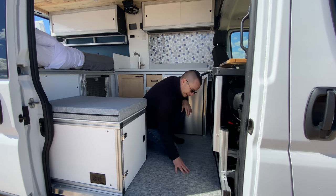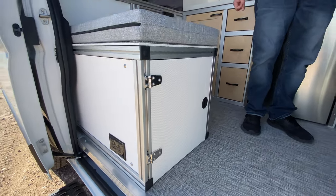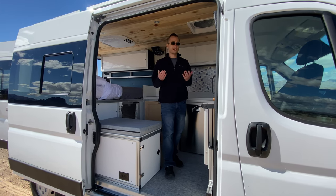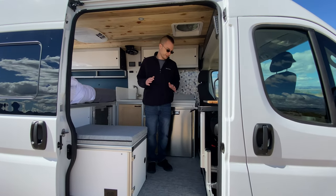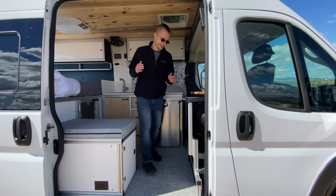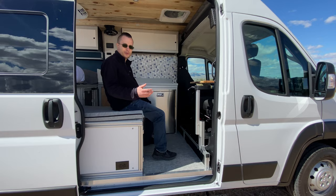You'll also see our King Starboard — another marine product that we use pretty much everywhere where you would typically see a wood panel on other vans and RVs. This product won't swell, warp, or rot over time, and there's no need to ever refinish it. If you have an RV or a van with painted wood, you'll notice it tends to get messed up fairly quickly and you're going to want to repaint it — especially in a small space like a van. This product is far superior to wood. It is a decent amount more expensive, but it's definitely worth it. We try to do every panel bolted in, so if you ever want to change out even for a different color, you can fully remove these and not affect your structure at all.